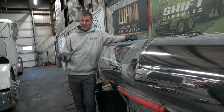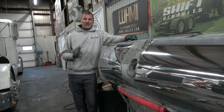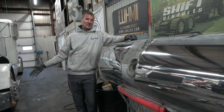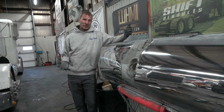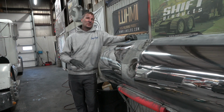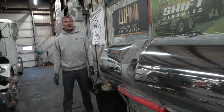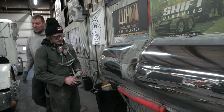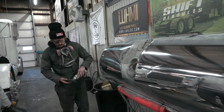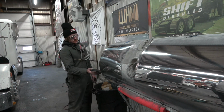But now between the regular brown and the show brown, regular brown is roughly 380 grit, and the show brown is about 800 to 900 grit. So we need to clean this brown off again to make sure we don't contaminate it with the show brown. So now we're just going to go really light once again. We're not putting a whole ton of pressure on, just lightly wiping across it, keeping it thin. We don't want to get too thick because otherwise that too will clog up the pad.